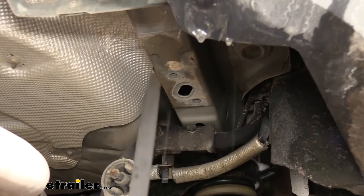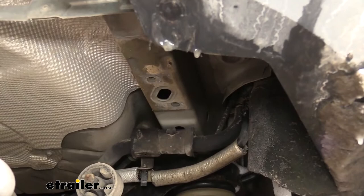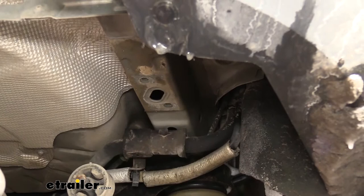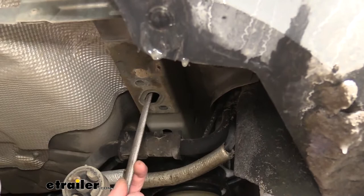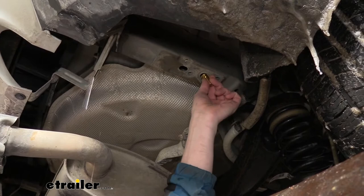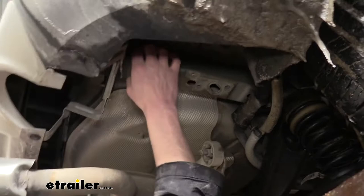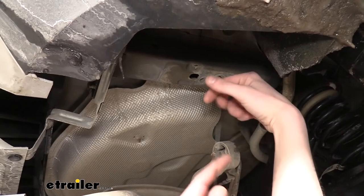The elongated opening where we had trimmed out the heat shield is going to be our access hole to feed our hardware in. We'll need to enlarge the hole until we can get our carriage bolt fed in. It's pretty close — it almost slides in right now — but we are going to have to make a little groove in it using a file or a grinding tool, whatever you have available. Once the hardware fits, we can feed it into place. We're going to come out the access hole and also through a hole on the side, starting with the side hole first and then the one on the bottom.